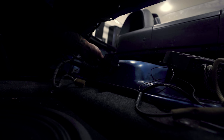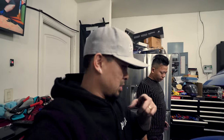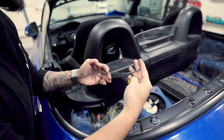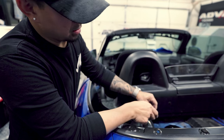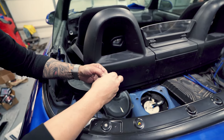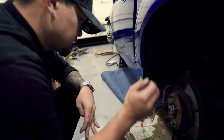All right, it's day two. What we're going to do now is the relay wiring. What we want to do is clip off the power for the fuel pump that goes to the car because we want this to go to the relay. So we want to cut the power from the connector off and then wire it into here. What I'm going to use is these awesome Deutsch connectors — make it clean, no soldering needed. First, what we're going to do is de-pin this.